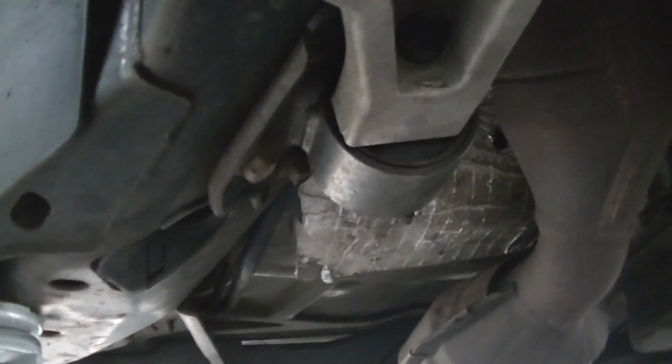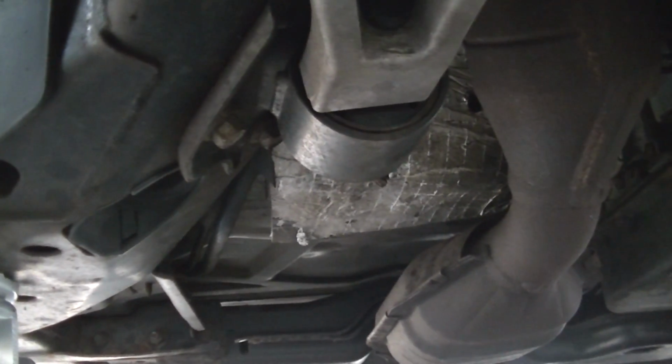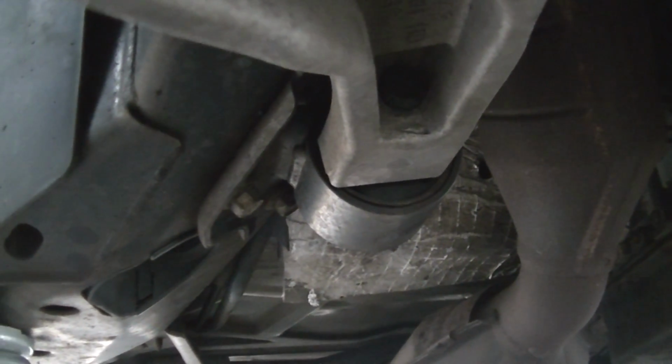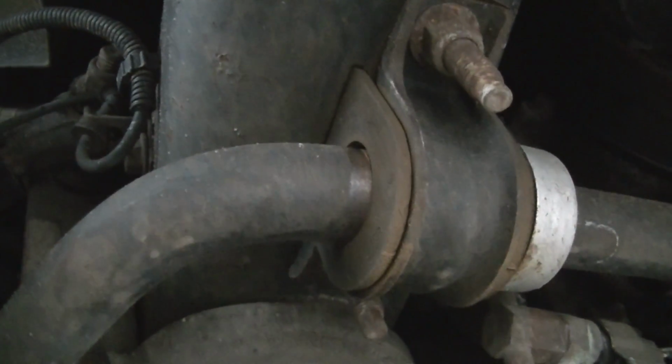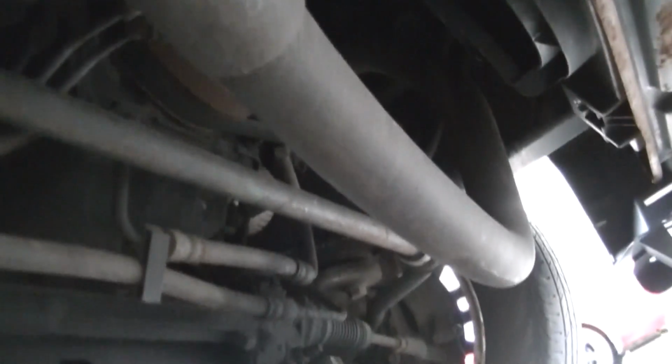And I was thinking, see that bushing in the back? I was thinking I may need one of those also, because it's making a rumbling noise underneath when I turn. So I may change that also, or I'm going to look at it in a few minutes and really see if it's that. This sway bar, I'm going to take it out. I'm going to put in a little beefier one from an Interceptor. So I will definitely take that out. Look at the hose, it's exposed right now. That's not a good look. It can rub and rub and rub on something. Eventually that will pop, and I know that.